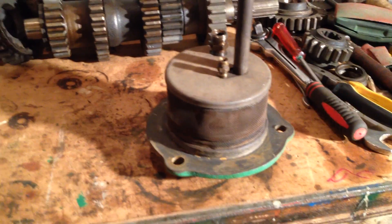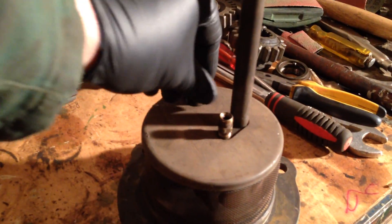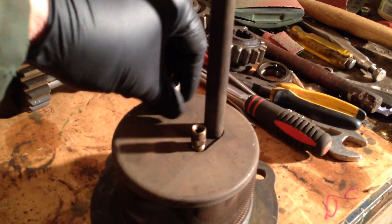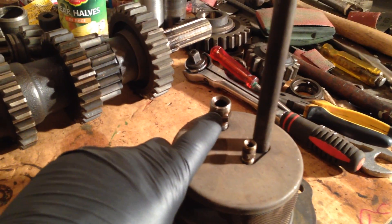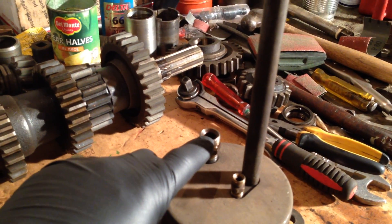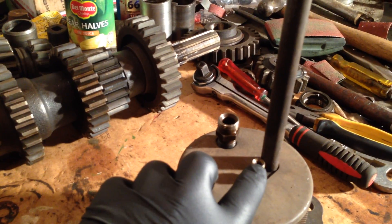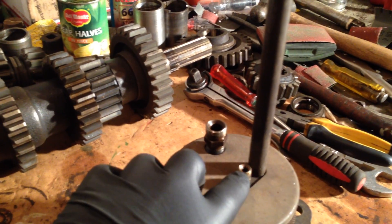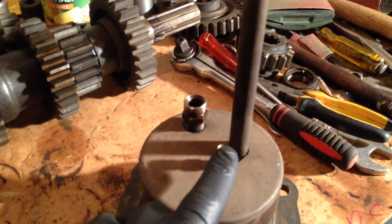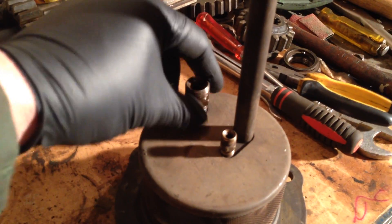To remove this screen you've got to take these two nipples off. This nipple here is the main oil feed — that's the one the pipe comes off that feeds the crankshaft bearings and all the heavy-duty bearings. This little one here takes a line to the front of the engine to the tappets, going through the block and through the head to feed the valve tappets.